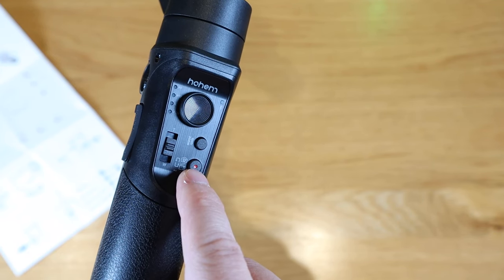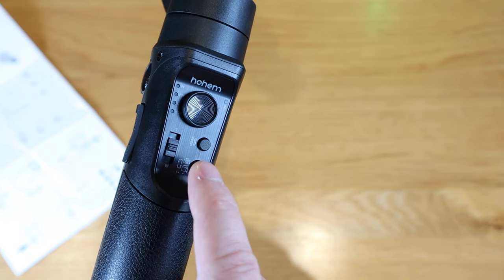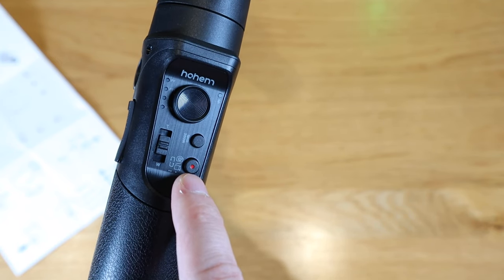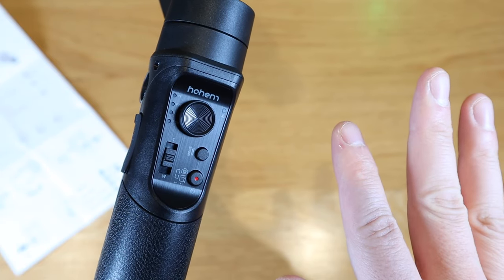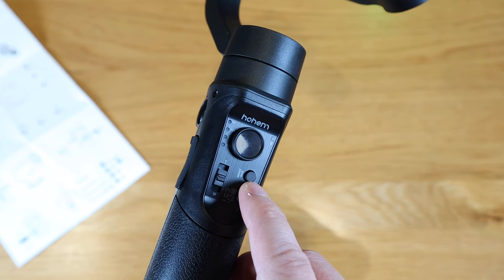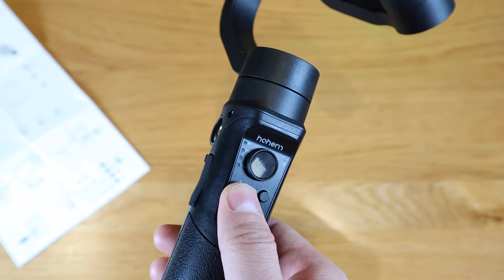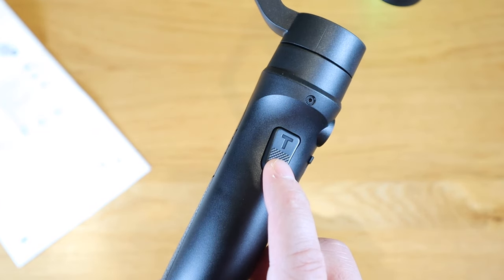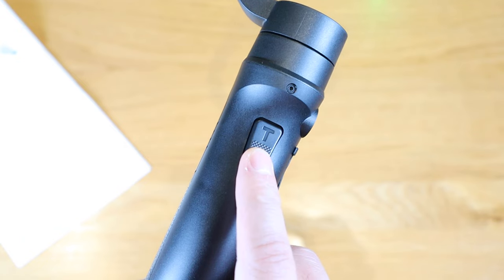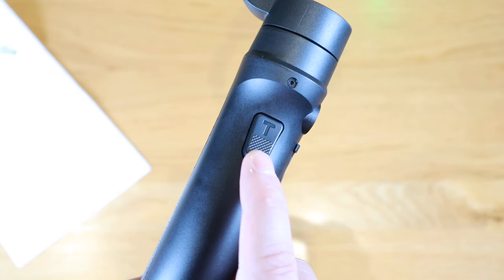This button is not only for power on and off. If you press it once, it initiates recording or taking photos. If you press it twice, you swap between using a singular camera or recording videos. If you press it three times, it changes the lens from front to back. There's also a toggle button for manually moving the gimbal, and another button to change to PF, PTF, L, and POV mode. The T and W buttons let you zoom in and zoom out. Press and hold the T button for sports mode, press once and hold for all-lock mode, press it twice to recenter the gimbal, and press it four times for ultra wide angle mode.